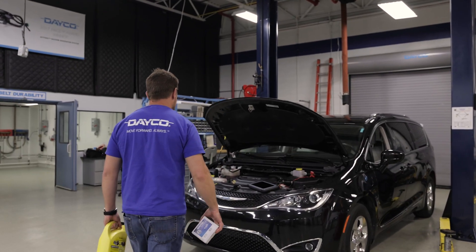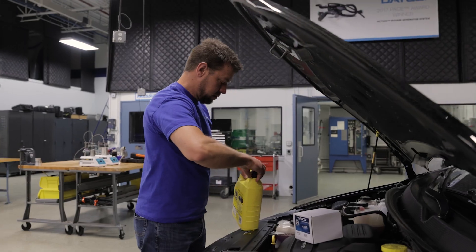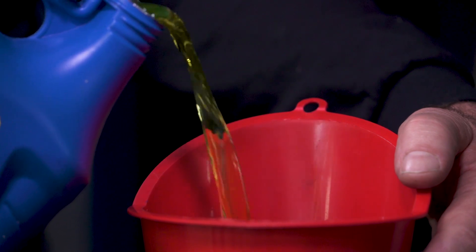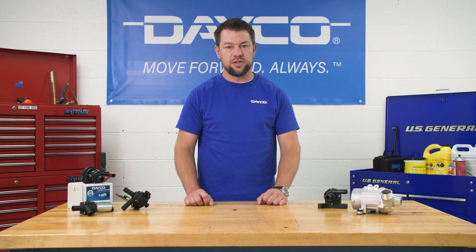There are three key mistakes with electric water pump replacement. The first mistake is mixing various types of coolant and/or mixing coolant with tap water. This causes a chemical reaction that restricts coolant flow — this is a recipe for disaster. A 50-50 ratio is needed for proper performance. Diluting or enriching the coolant mixture removes anti-corrosive properties and impedes additives designed to keep fluid from freezing or boiling. It may seem like a small mistake, but it has big consequences since it can damage the pump seal and cause failure way before the product's intended service life.